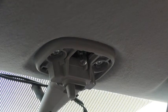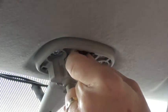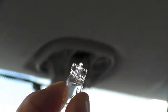The bulb is a standard 501 type, similar to the type you get in the side repeater bulbs and in the upper rear brake light. All they do is they just pull out — they're called a capless bulb. You just have to get your fingers around it and give it a little pull, a little wriggle and a little pull. They come out and they've got no actual cap on them.